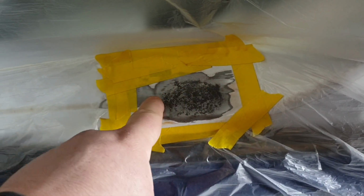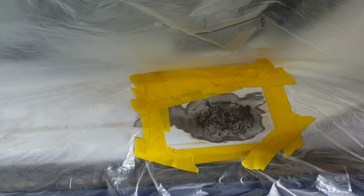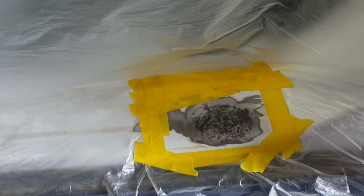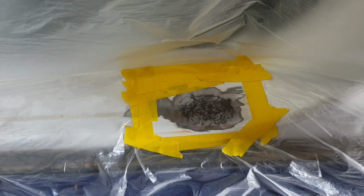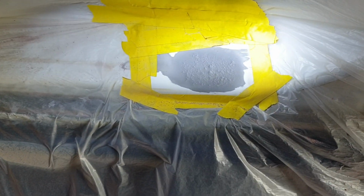All I need to do is sandblast that crap off, and then we can just skim a bit of filler on it, bit of etch, rub it down, done. And that's going to actually be a lot better than I expected. There we have it, rust be gone. That's legitimately as good of a repair as you could do here.